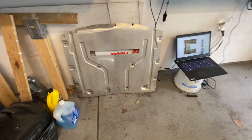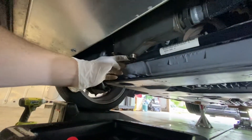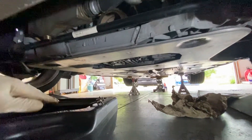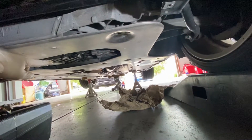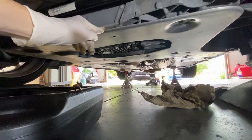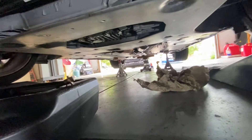You're going to have to take off the under tray. On some cars it's actually plastic, but on mine it is the heavy duty metal one. That gives you access to the drain plug. I've already got the drain plug out — that was a 13mm bolt. The metal tray also uses 13mm bolts, but there are some Torx screws as well, so you'll need a Torx driver. You can't actually get to the oil filter without removing the next panel that goes about a quarter of the length of the car, and it's pretty heavy — a bit of a pain to get back on when you're alone under the vehicle.